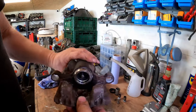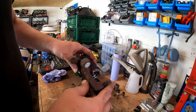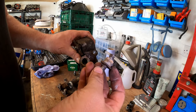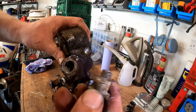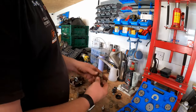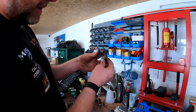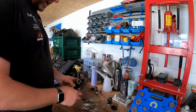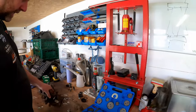What I've done is given them a good scrub to get rid of any loose corrosion. You'll also see that I've removed the stub of the handbrake cable - you can see why they didn't want to come out because they were absolutely stuck fast with corrosion. What I ended up having to do was get a drift on them and whack them until they came out - they started to bend, I did have to really bray on them to get them off, but they're done now.